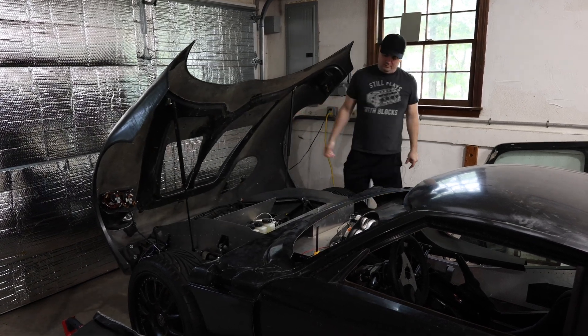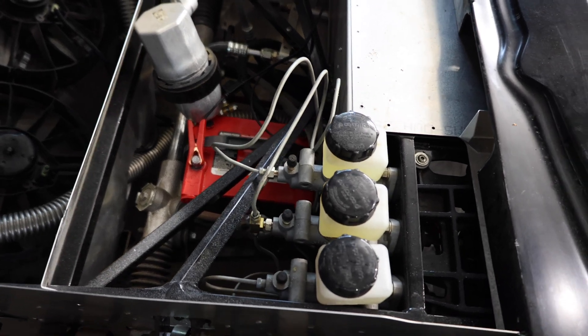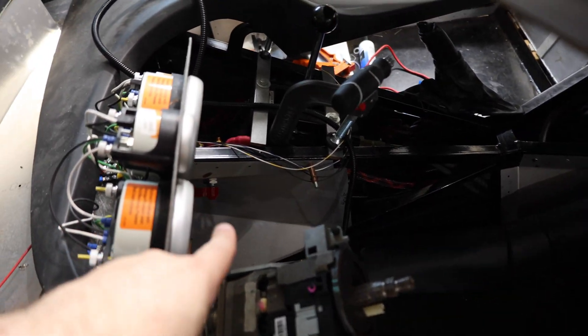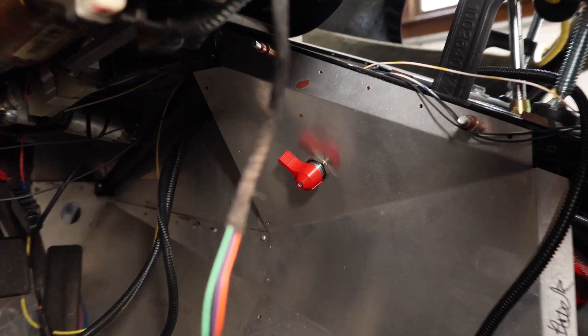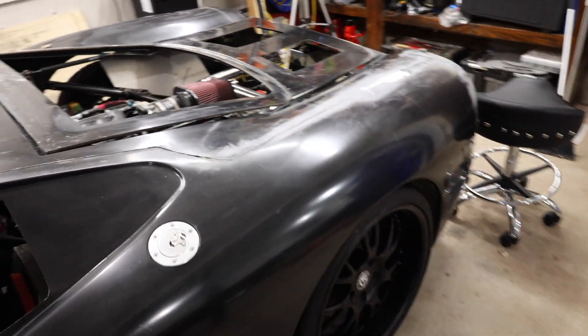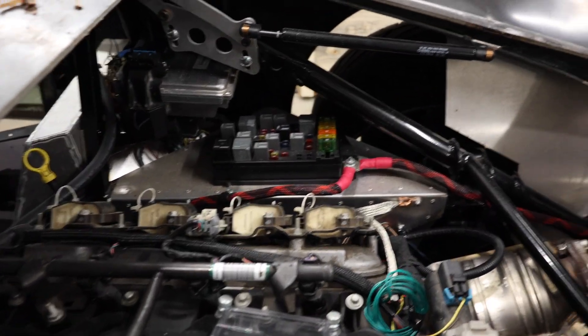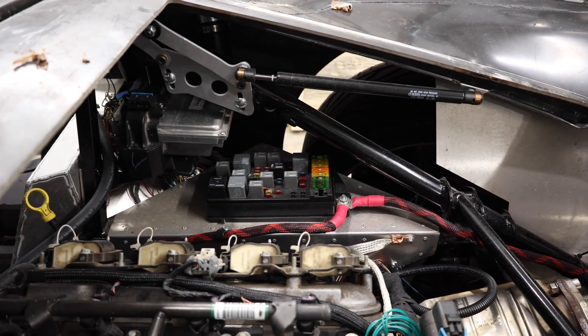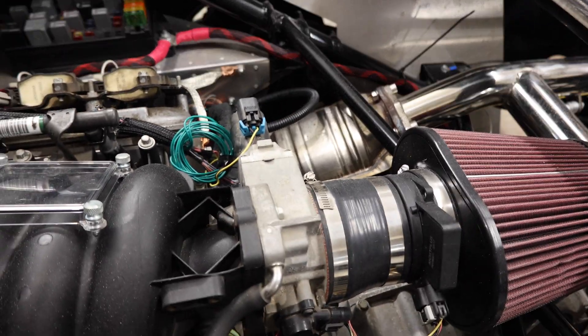The battery for the car is up in the front of the chassis — you can see it down there — and the positive lines run under the center where a drive shaft would be in a typical car. There's an on-off kill switch right next to the driver, with a bunch of cables going there. From there those cables go back to the rear, all the way to the fuse block — a fuse block out of a C5 Corvette — and then one goes directly to the starter underneath. Any short in this line would surely cause a fire, melting the line and causing an issue. So we need to make sure we get the fuse in the right location.